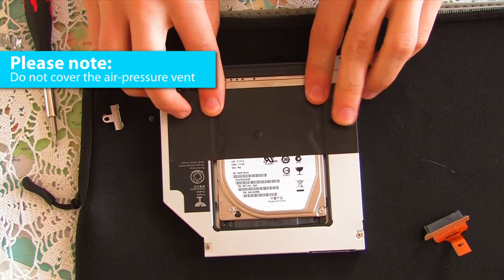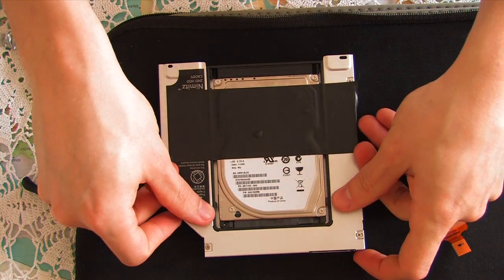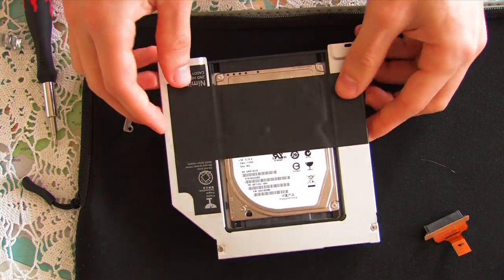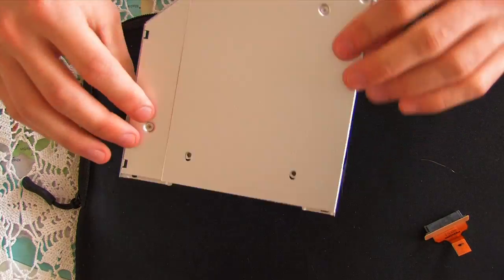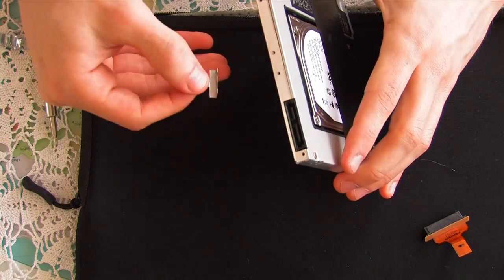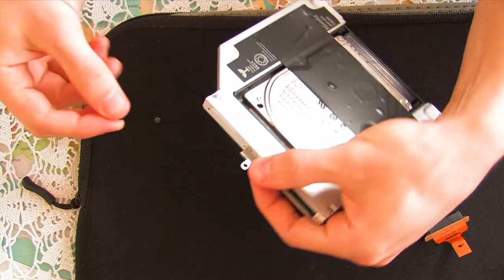You may also notice that the hard drive doesn't quite fit snugly into the caddy. They've put little rubber stoppers on the sides to stop it moving side to side, but even that is a bit lame. So the sticky tape will definitely stop that — up and down, left and right, that's secure. The next part is to reinstall that little bracket we took out of the SuperDrive, using the two Phillips screws.